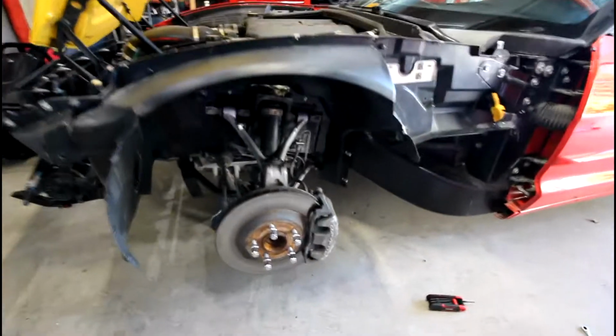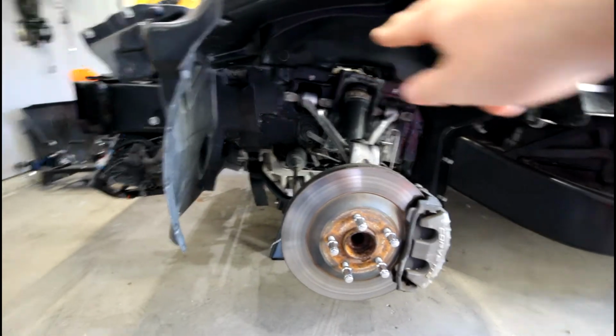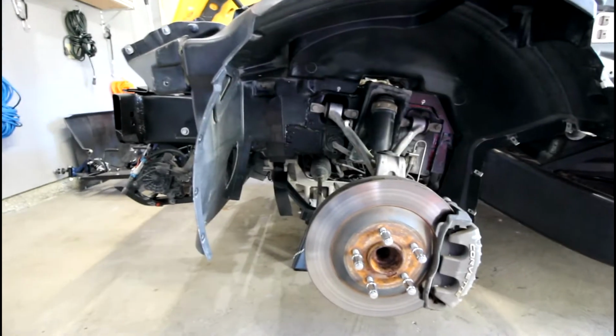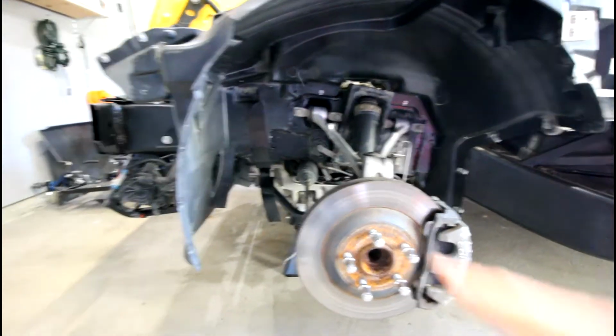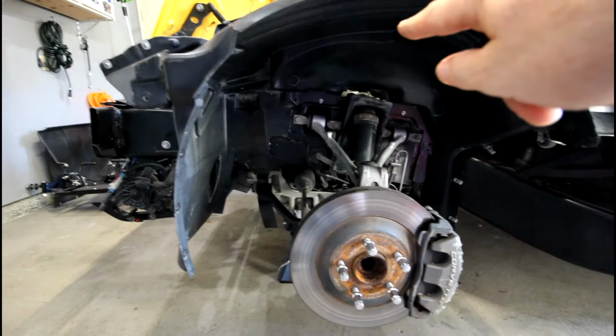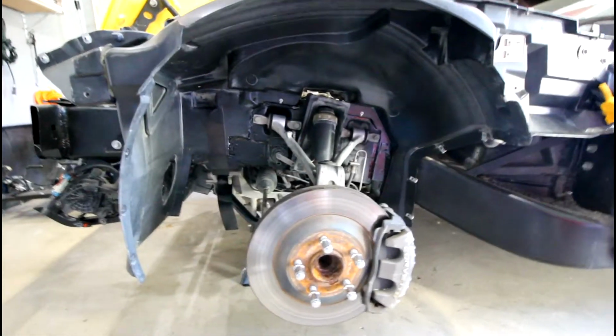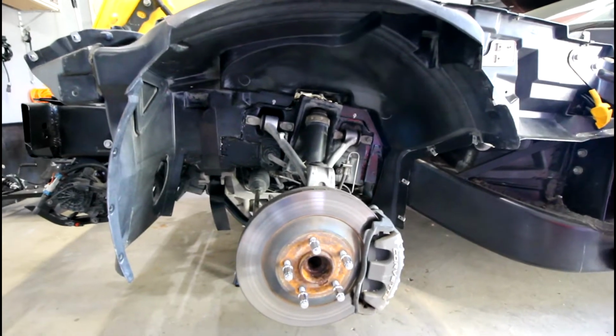Sorry, one other thing I forgot to mention, I also did a few alignment points, and I outlined where the fender stopped on the inside here as well, because that really helped me to get it to line up in the same spot. I basically traced all the steps, because there's a bunch of steps in the fender, and then it goes up and around and steps down on the other side. So I traced that, and that helped me also align it using those points as well.